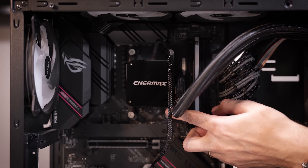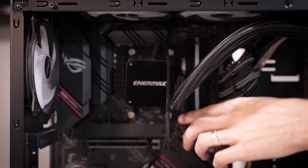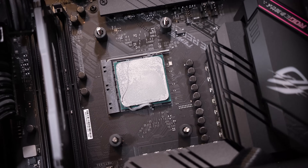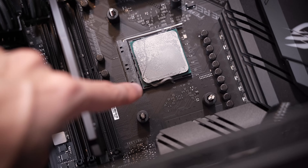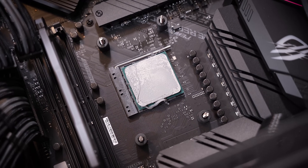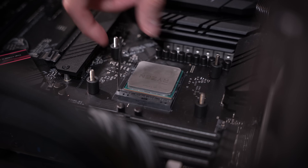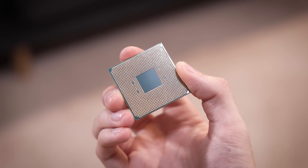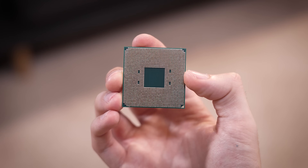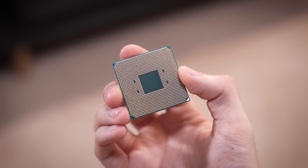You can also tell that the block here looks to be slightly crooked because he used the wrong holes on this bracket to tighten everything down. If the I/O is fine, we'll make sure to straighten this up for him. We definitely have more thermal paste than we need, some running off the side there — that can get under the chip and into the socket as well and cause issues, so we'll clean that up. This is indeed a Ryzen 9 5900X. Let's check the socket and the pins now. The underside of the chip actually looks really clean — there was a bit of thermal paste runoff underneath, but it wasn't impacting the totality of each pin. Clean that up a tad and yeah, looking spiffy.